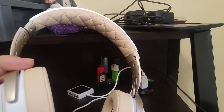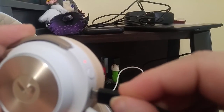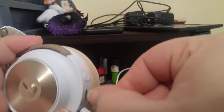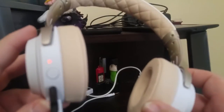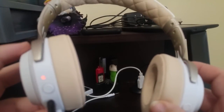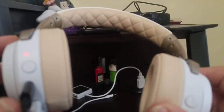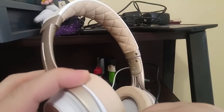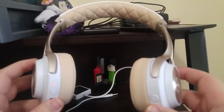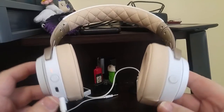So how do we give it more juice? I have the answer right here — just a little USB mini that gets plugged in. It gets plugged in just like that, and you're going to charge it. It can charge and be used simultaneously. So if I was sitting at my desk with a phone charging station, I could very easily charge it with my normal phone charger and also listen to music at the same time. You do have to remember to charge it though — the charge only holds for a couple of days with regular use. I used it for about three days in both powered and unpowered modes and found that the battery had run out by the third day without recharging at all during that time period.